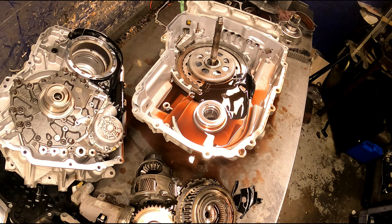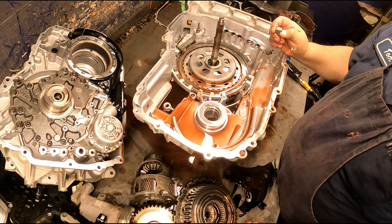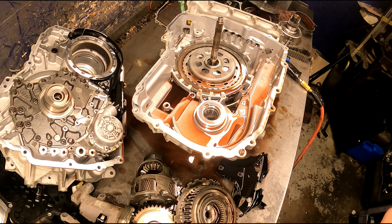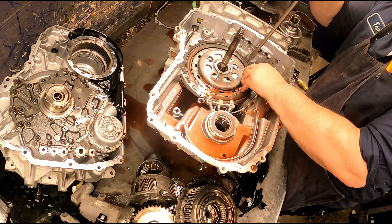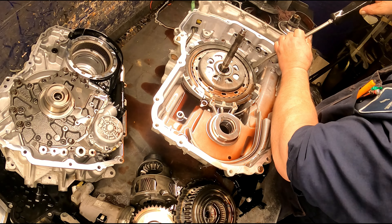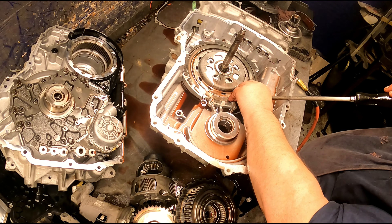Look at our diff, make sure our pinions look okay. The bearing in here feels okay. Check our spider gears — that all looks okay. We've got a washer and a bearing here. Pull our gears off and check the bearing — feels okay. Look at our teeth where the chain rides and make sure it looks okay. Check this bearing surface to see if it's worn down; if it is, there is a kit you can buy to fix that. Pull our baffle off — another transfer gear, looks okay.